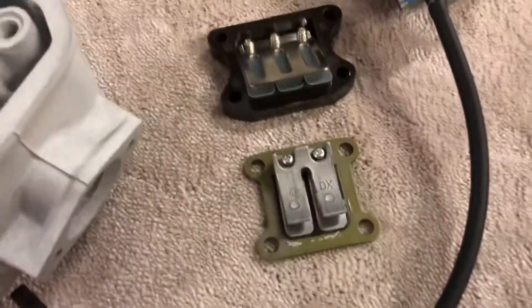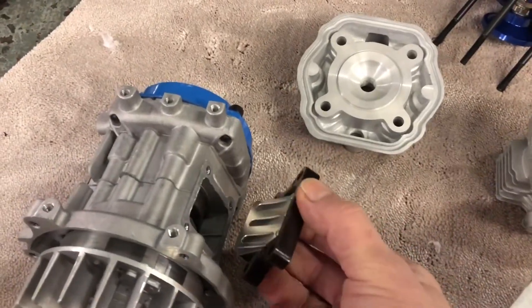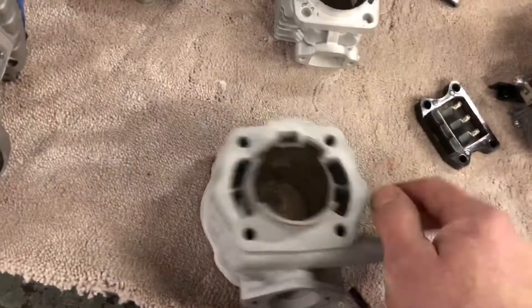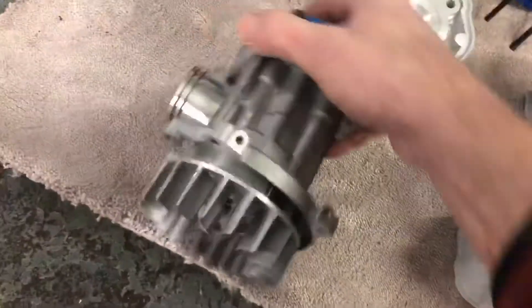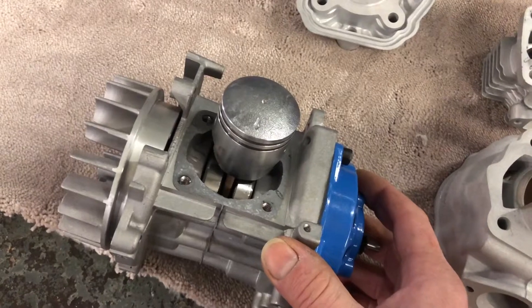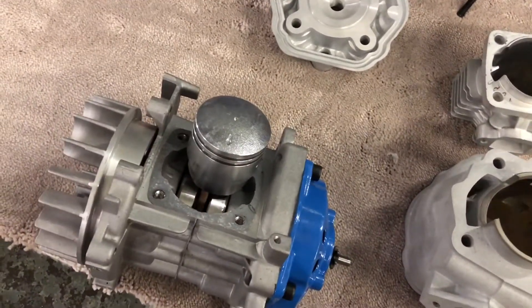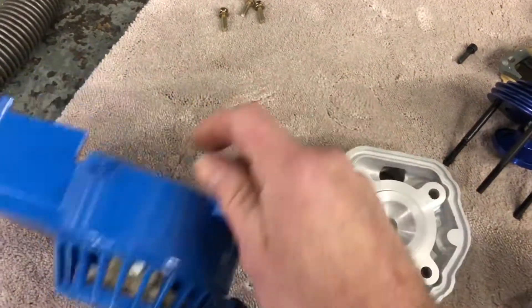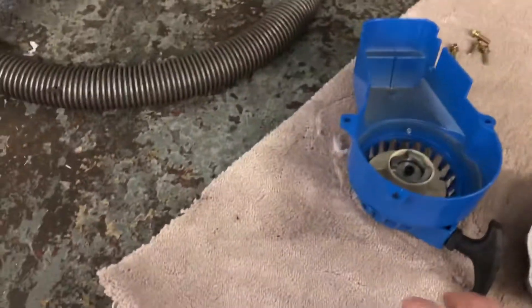I also got a bigger reed block — this one is from a Gilera Runner or a Peugeot Speedfighter. It's actually got three petals or reeds instead of two, giving a larger effective area. I can machine this reed block to fit in the case. I'll need to do a bit of machining on the bottom of the barrel and cut them a bit shorter. There's also a little bit of welding needed on the transfer port area as they're a bit tight. I can lose the fan since it won't need to be fan-cooled, and I'll probably run an electric starter, driving through a toggle on the end of the crank.